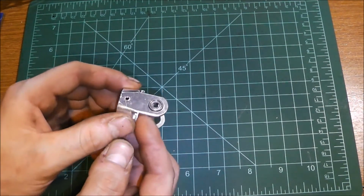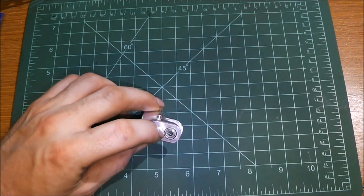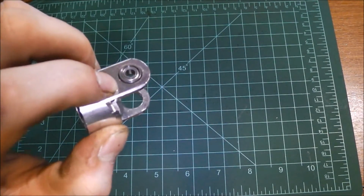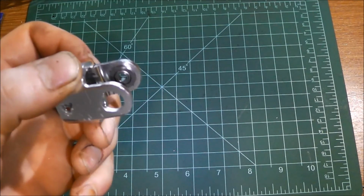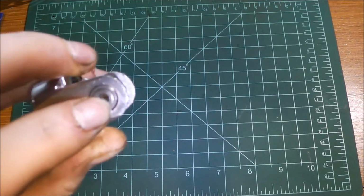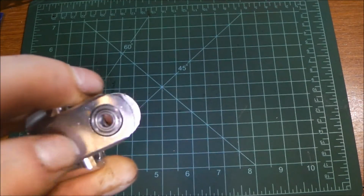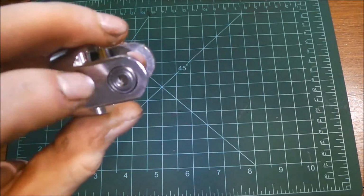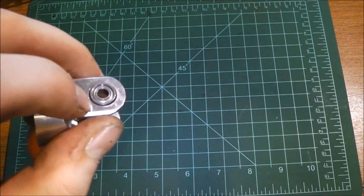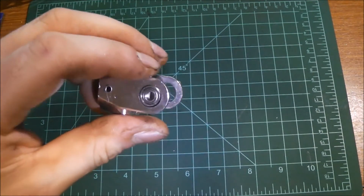So what you do is, it's called wicking too. People call it wicking Loctite. I don't know if you could see the outer race here where the bearing seats. It's a flange bearing, so it sits up on the backside here on the shoulder, which is the flange. Then your bearing's in there, and on this outer shoulder is where it gets wicked into the metal. This actual brace it sits in on the tail boom is a tail case. You wick it into this, and I'll show you how it's done here if you want to see how I wick the Loctite in, which is really helpful.